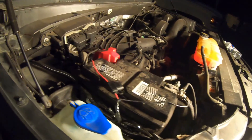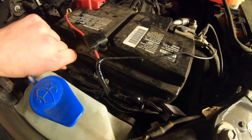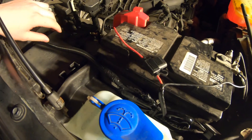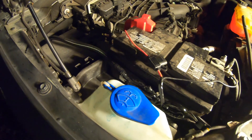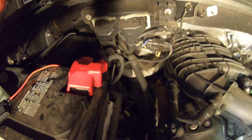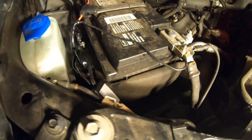Everything is wrapped up and all wiring is connected. Here's the switch assembly — we shortened some of the wires and reconnected them via soldering. This is the single wire that comes from the two spliced lights. It goes down and is tucked behind the fuse box area, routed to avoid anything potentially hot. It follows one of the frame rails up from underneath the truck and everything is connected.